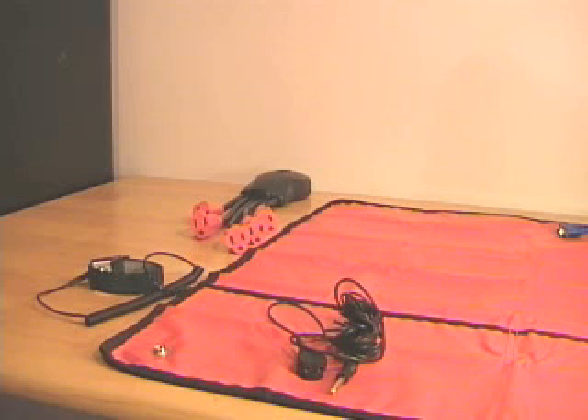As we get started I want to talk a little bit about safety. We want to make sure that you're protecting yourself and your components from damage. Before working or opening a computer you want to make sure that you use common sense and standard preventative measures against electric shock and ESD. You should not work on a computer that is plugged in and turned on, and you should always use some sort of anti-static measure, whether that's an anti-static mat or a wrist strap.